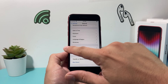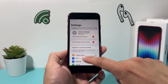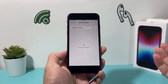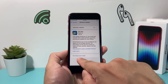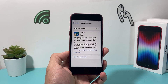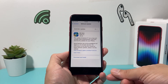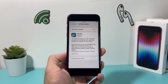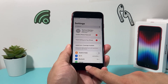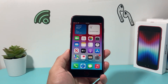After that, if you're still having issues, update your phone to the latest software version. Go to Settings, then General, then Software Update, and check if an update is available. If so, click Download and Install. Give yourself about 30 to 45 minutes for the update. Make sure your phone is at least 50% charged or plugged in, and that you have a strong Wi-Fi or cellular data connection. Hopefully after the update, your Touch ID and fingerprint reader will be working again.